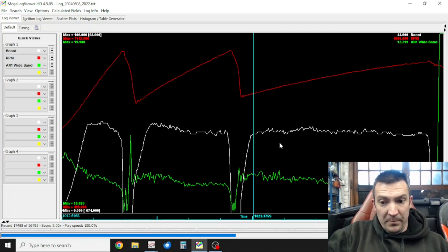I think we've nailed good boost control. I might be able to get more boost out of it by upping the boost value, but around half a bar is safe going. The modifications to the wastegate have been a success and we've now got good boost control - we are less likely to blow the engine up. We'll call that a success and call that quits for part 4. For part 5 we're going to finish off the charge cooler, plumb it up, get some water through it, get some brackets on, and at that point we should have a pretty much fully functional turbo MR2. Thank you for watching - don't forget to like and subscribe. Until next time.